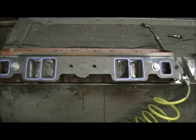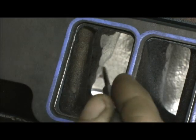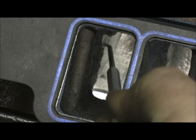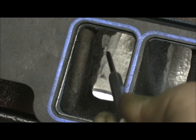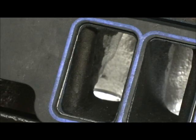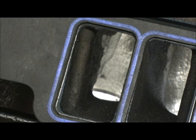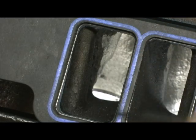Let's look inside the ports just a minute. Remember how I was bobtailing the guide and gnawing on that wall, trying to pull it back? Now comes the dot-to-dot time. Our grinding has created quite the shoulder right here — you can see the bulge. So now what I've got to do is come in and use the Butcher Hog, the big double cross cut 9/16ths egg. I'm going to connect the dot, pull this hole down, and go on an outward strike to pull in that wall.